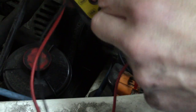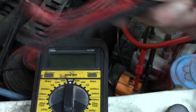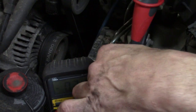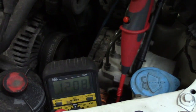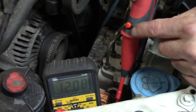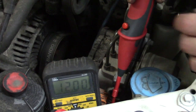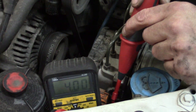So all I'm going to do is remove my usual DVOM leads that I've been using for the last five years and in every video that you've seen — and I'm probably going to actually throw these away — and I'm just going to go ahead and connect up my leads for the Load Pro. All I'm going to do is just go ahead and do my voltage test just like I did before using my Load Pro leads. We can see that we still get 12 volts as before, so nothing different here. Now here's the difference: when I push this button, we're going to put a small load through the circuit. And of course, when it meets the resistance, we're going to see a voltage drop here if we have a voltage drop problem. So let's press that button and check it out.